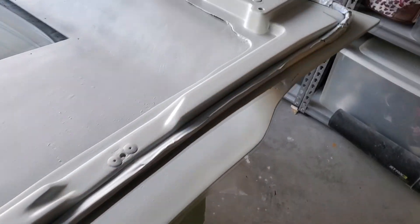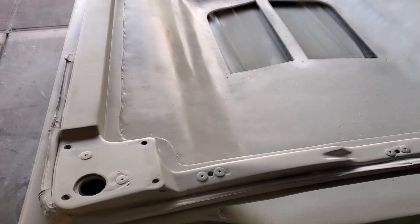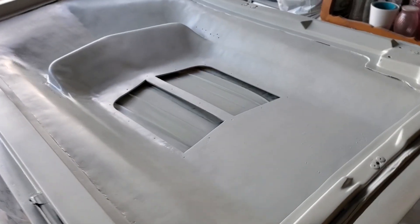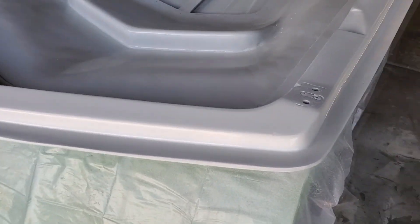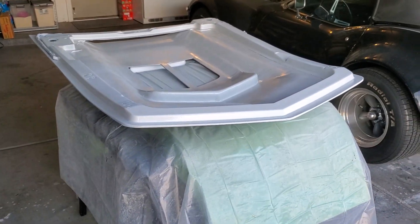Like I said, you can still see some of the imperfections. This is why I do the filler primer — so I can always see what I missed. I need to fill in a little bit right there and in this area right here that I just can't see — a few scratches. But overall, this is the underside. I'm not going to spend forever on this because it's just wavy fiberglass, so it's going to be what it is. I will fill in these little areas and make it look nice. But unless I want to block for hours and hours, it's not worth it. It would be worth buying another hood and doing it correctly. So we'll let that sit and do its thing.